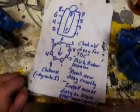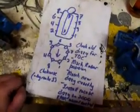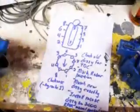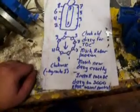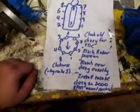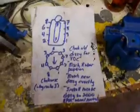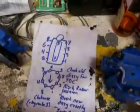The other thing with Chevys is the marine motors that go in boats. I have seen the distributor, instead of spinning clockwise, spin the opposite way. So everything is backwards. But chances are you're not timing a marine engine, and I've only seen that twice in my entire life. Somebody actually bought one and put it in a Monte Carlo and could never get it timed, and we called in the block number, and it was for a marine boat, and the guy said try flipping it around, and we did.